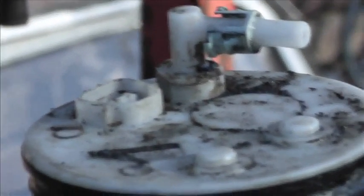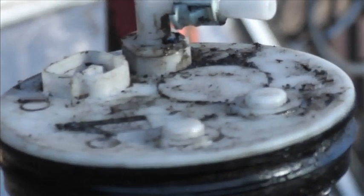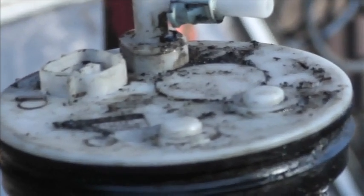Right, okay, I think we're all back on track now. In that socket there are 5 connections, and I want to find out which ones are for the sender unit. Now it looks like we've got 2 to the motor there, 2 to the sender unit there, and that extra one down there, which I'm not sure what it's about. I'm thinking if the tank was pushed back and it damaged some wiring behind, has it affected the, mind you, it's 2006, so I don't think it has CAN on it, so we'll ignore that then. Maybe it's affected an earth somewhere.